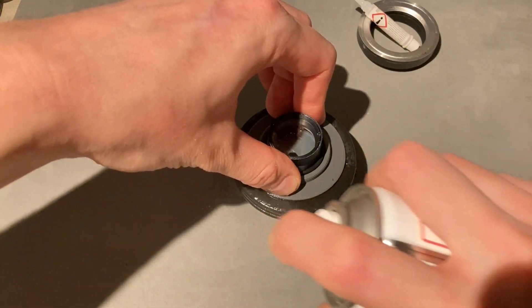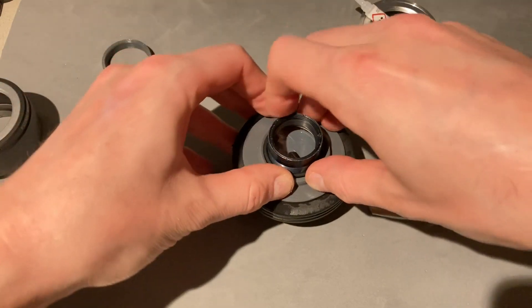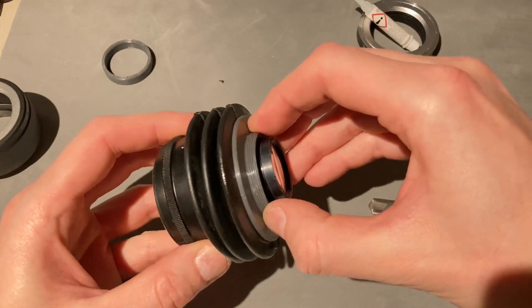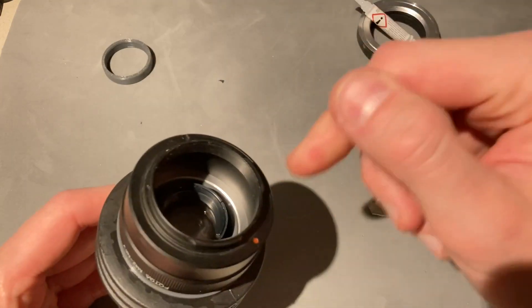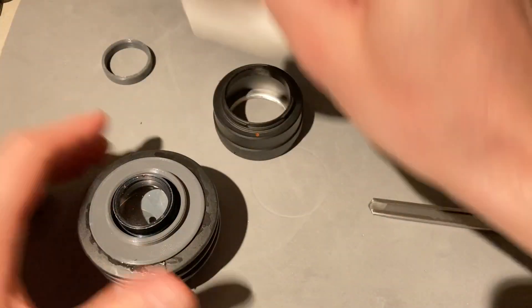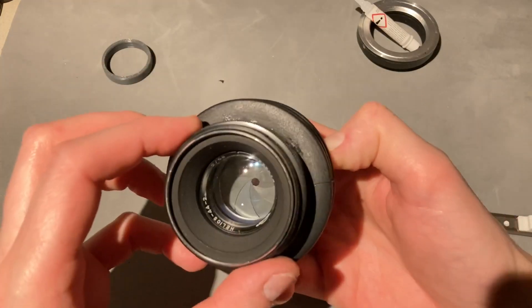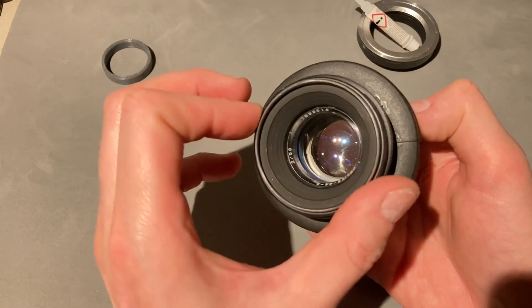Since it's oriented already, I can press down on it without shifting it. It moves a bit. What's also important is that I can't press it in too deep, to avoid it moving inside the camera and damaging the shutter or sensor. Let's clean it from the residue of the activator spray. You don't turn the ring — you turn the lens — and the aperture is somewhat fixed.